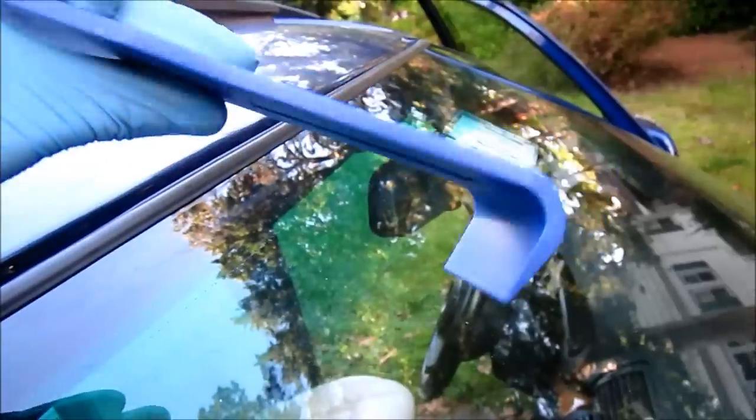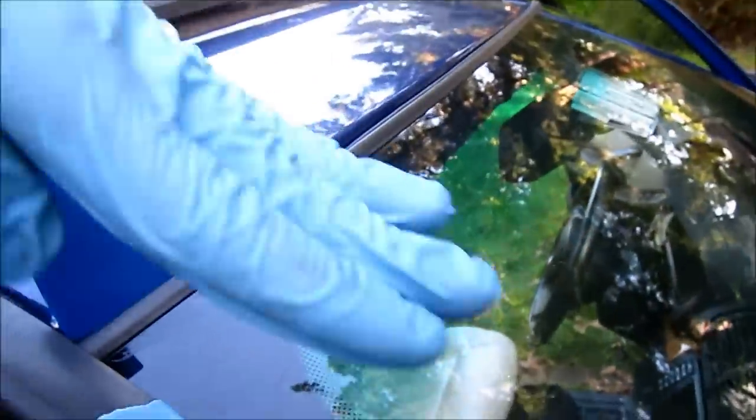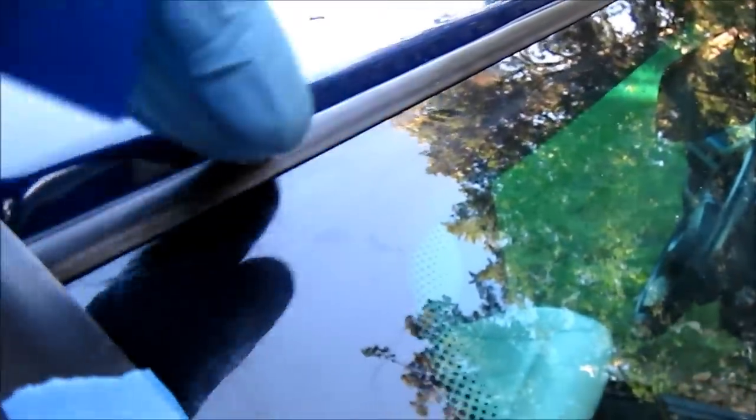It's really helpful to have one of these trim removal tools. What you're going to do is clip on one part of the trim as best you can. Once you manage to seal it along the glass, use the tool to insert between the part that comes out and the main thick part, and dig and scoop onto the windscreen itself. Just go a little bit at a time, pushing in until it's all flush.